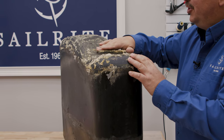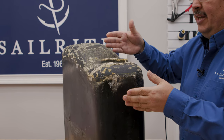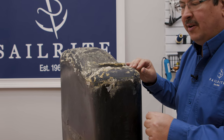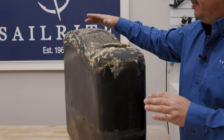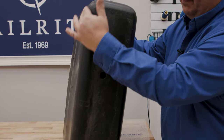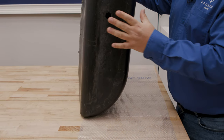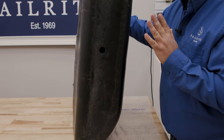Why? Well, there's shape in this top, and putting pattern material on this top would obviously give us a pattern that would seem like it's going to fit really well. But since we're using a four-way stretch vinyl called Eversoft, it's going to take this shape beautifully, and we're going to pattern off the bottom. Now, the bottom has no shape at all except for the shape around the entire perimeter. That's the important shape. This shape will be transferred to the top, and the four-way stretch vinyl will stretch beautifully